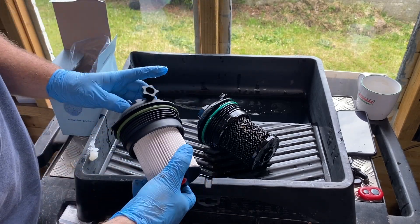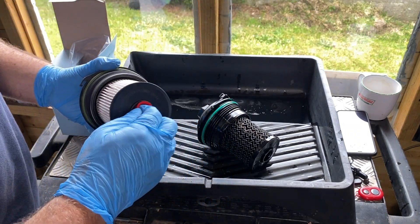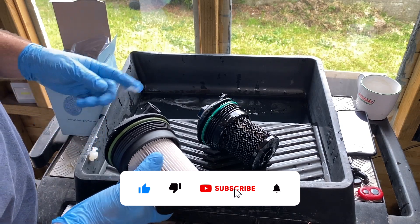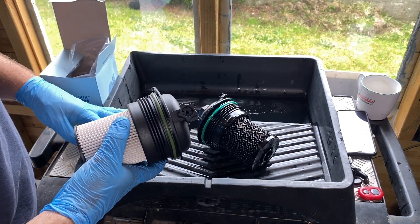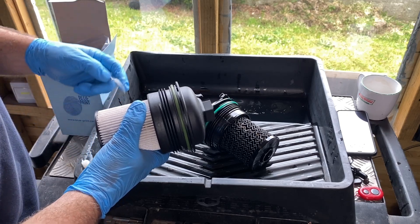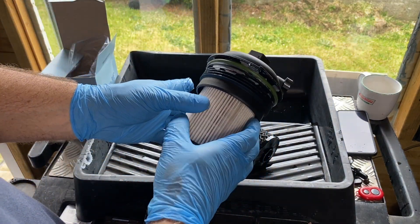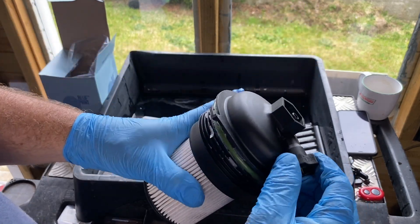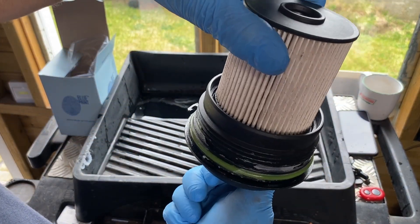No cleaning required — you just have the clean new item. Essential: take out that plug from the bottom. If you don't take that out it's going to be a world of pain. I've got some Vaseline here — just vaseline up this seal. This makes it easier so it won't drag as it goes into the housing or roll on itself. That's all we require for fitting and it'll be preventative for the future. Do this up and make sure it's tight.